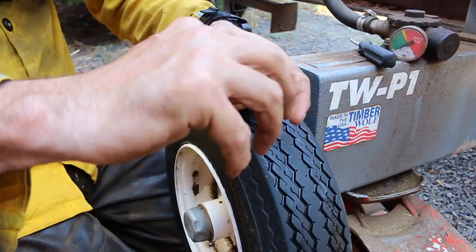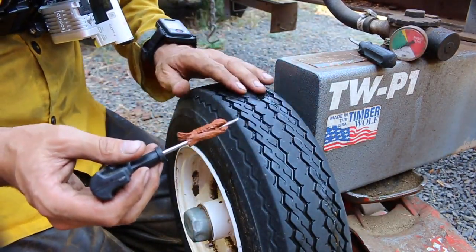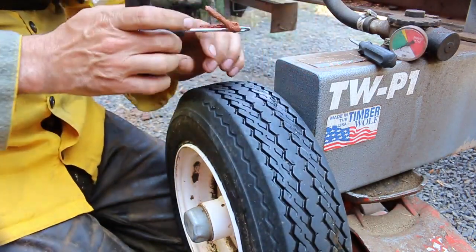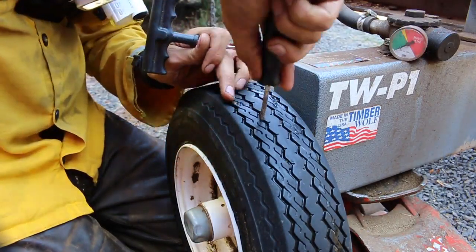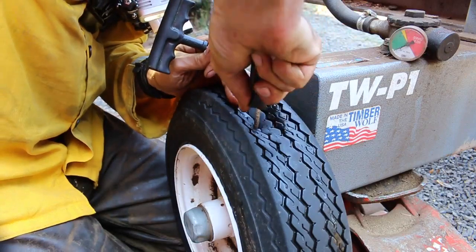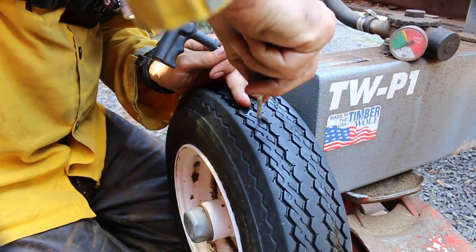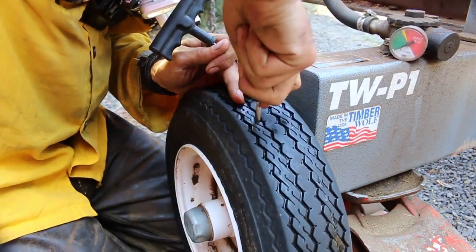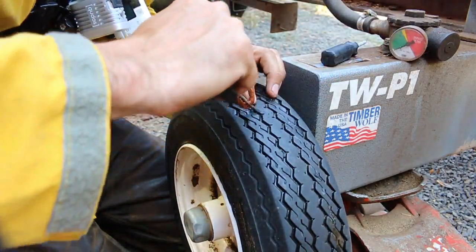You can do this in the field. Now, your reamer — after you pull the nail out, you ream the hole out really good. You actually increase the size of it a little bit. That's okay, it's not going to hurt anything. Just go ahead and run that through there a few times, because you need a hole big enough to get this goo in there.